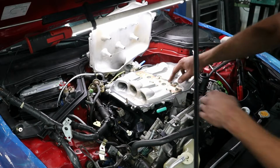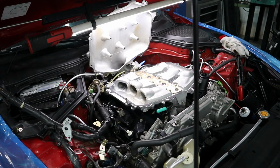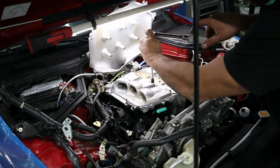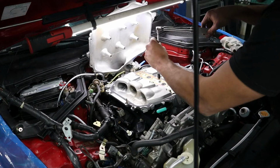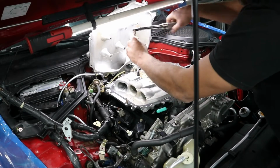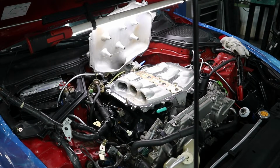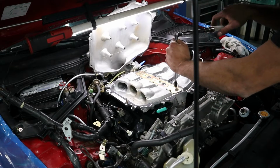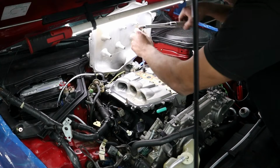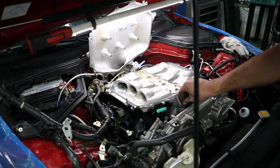And these guys, you're going to torque them to 114 inch-pounds in the sequence, starting from, I believe, this middle one right over here. So this is going to be actually the start one. So it's going to be 1, 2, 3, 4 is up front. This is 5. 6. We'll see which one's the front. And the 2 nuts are going to be 7, and then 8 is going to be all the way in the back.